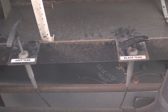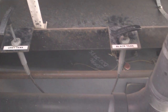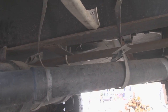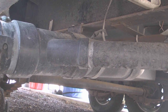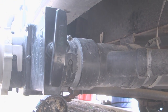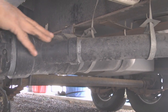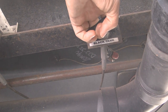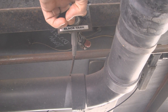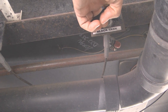So what you see here are the gray and black dump valves. The gray dump valve is open. If we move the camera over here to check out the plumbing of this RV, you can see this is your gray water line coming into this main Y-junction. Now this valve is closed. So basically, at this point all the gray water has got all this piping system full of gray water. Now we're going to reach up in here and pull the black valve. When we do that, all this water that's in the gray tank is going to flush into the black tank, stir everything all around, and kind of clean it up.